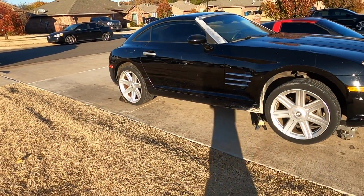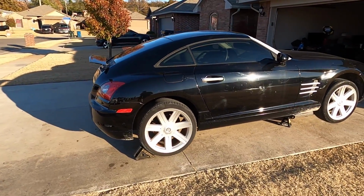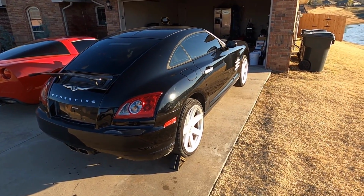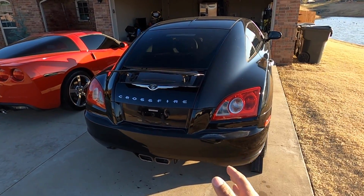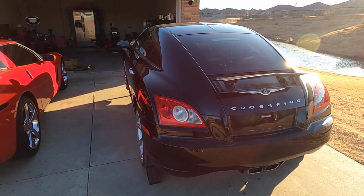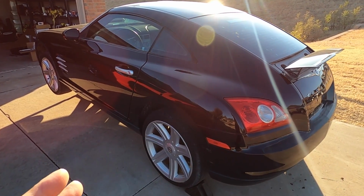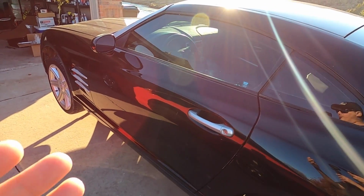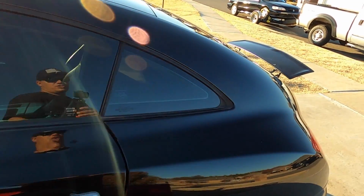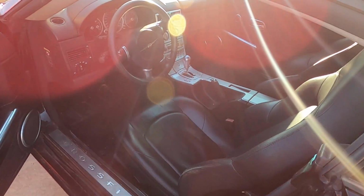She's not a bad looking car, and it doesn't run poorly. It's just that the transmission is stuck in limp mode, and that is a very common problem with the 722.6 transmission. So many Chryslers and Mercedes use this transmission for so many years. This is just a common problem. So if I were you, I wouldn't be overly concerned with purchasing a car like this with transmission issues, because most likely it's just going to be an issue with the connector itself or the conductor plate. It's really not that big of a deal.